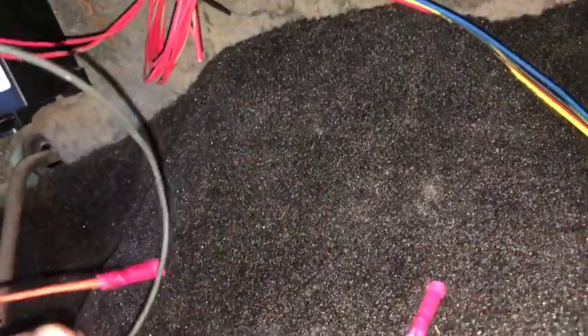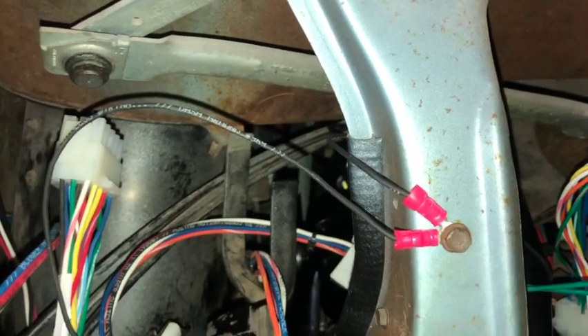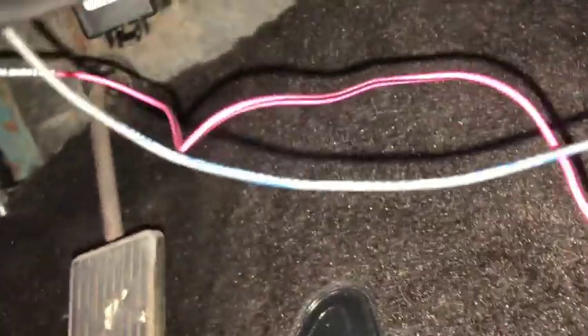We should have switched power for the ECU. The power itself comes from the battery and those wires are running up there. I ran the accessory ground over here to the same place I'm running the instrument ground, so hopefully that will give me a good ground for that accessory relay. My pink and black wire right here — you can see it's coming off my harness and I'm hooking it into that orange accessory power out. We should be good on our ProFlow connections. I know it's ugly right now — I've got to tuck everything up into the dash and make it look nice before I put the dash together, but I want to see if everything works first.